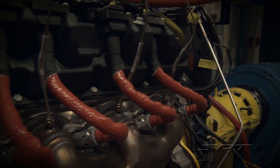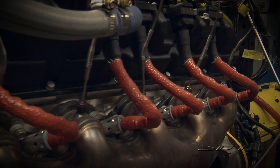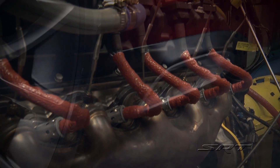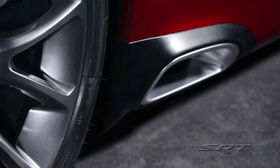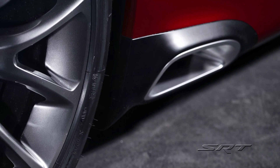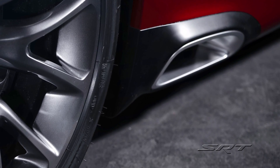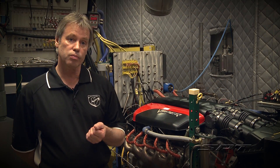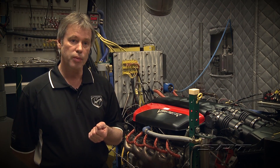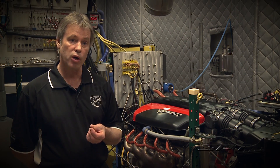This part being a tube-and-shell type manifold, it does a really great job of not only keeping heat out of the car much better than in the past, but it keeps the heat in to heat up the catalyst. By changing the wash coat process we were able to go to a single-pass wash coat instead of a two-pass, and that allowed us to reduce the back pressure through the catalyst by about three inches. That was worth six or seven horsepower by itself.